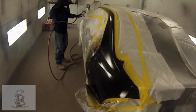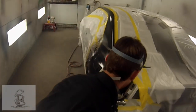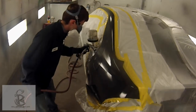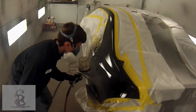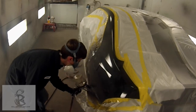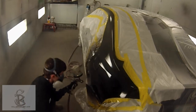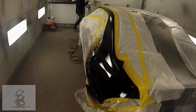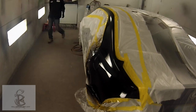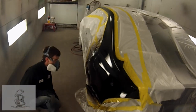Now he is putting his second coat of clear coat on. This is where you want to get it on nice and even — you want full wet coats. This is your UV protection, what protects it from the sun and where you get all your protection to the color underneath. He's got the second coat of clear on, it looks good. Now just let it dry — I'm going to bake it, then we'll pull it out. There are a few dirt nibs that we'll need to buff out and it'll be ready to put back together. Thanks for watching, and we'll see you in the next video.